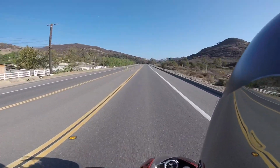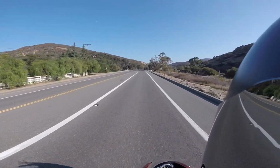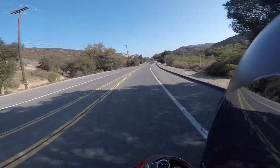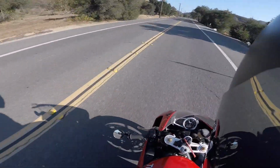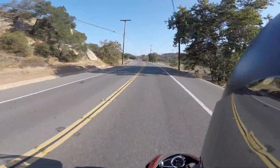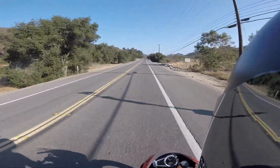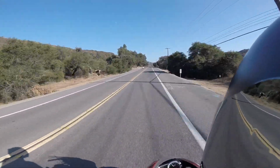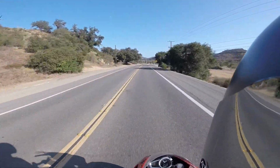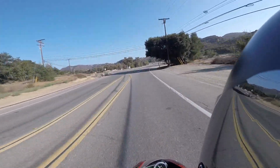So the second solution, wider rear tire. What's going on when you're exiting the corner on the gas? The rear tire is loading up and you're having issues with stability. By adding just that extra little bit of weight and also altering the final drive to make it a little bit taller, the bike becomes a little bit more stable. This also plays into turning in, and it still turns in really easily compared to my Honda or any of my friends' 600cc sport bikes. But I don't get the gnarly head shakes on the way out of turns as bad anymore.